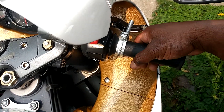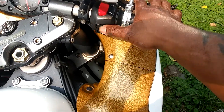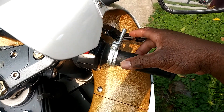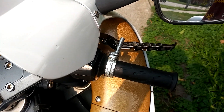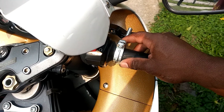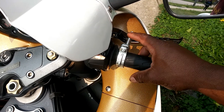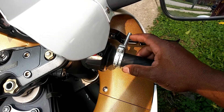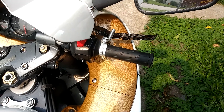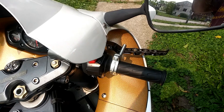So if you're going for long distance and your hand gets to cramping up — you know they got them little things that you just take your hand and rest your whole palm on. But if you twist this and then push the screw down, it'll lock it at a specific RPM. Keep in mind the RPMs will vibrate and rattle the homemade cruise control back to neutral, so you will find yourself slowing down. Don't think you're just going to rev it, lock it, and be set at 65 miles an hour — probably about 10 miles down the road you'll go from 65 to about 45.